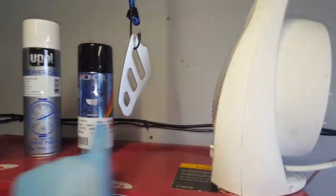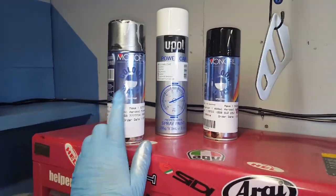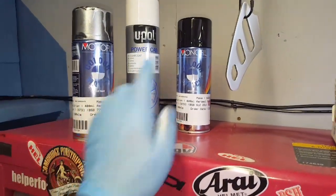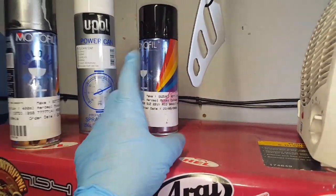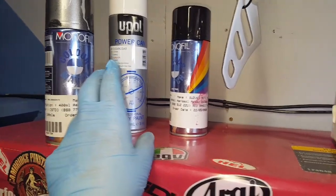I've just managed today to go and get the paint and it's a three-stage candy paint, I'll show you. I'm just basing up a test panel, so we've got three stages: we've got a silver base — well it's not actually silver, there are some colours in it — we've got the red 22U candy academy maroon which is a candy top coat, and then you've got a normal clear coat.